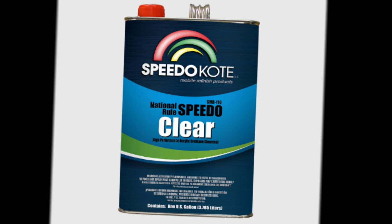And then we have the SMR-110. Now, this is the extremely fast dry clear. This will dry all the way down in 20 to 25 degree temps. These are three really good options when it comes to very cold weather painting.